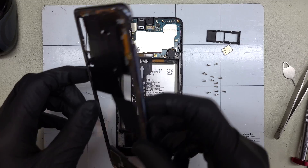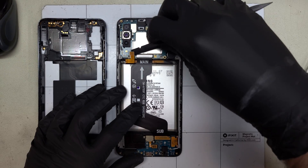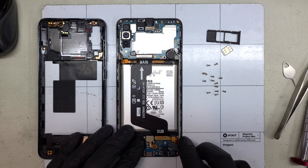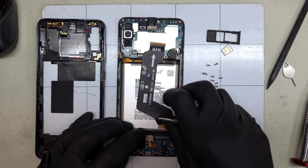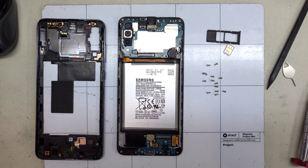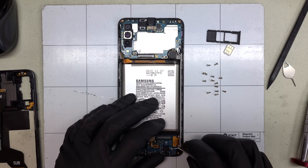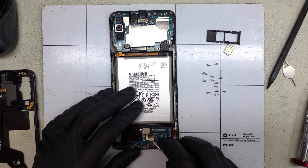Removing the midframe reveals a main and sub board connected by a very wavy ribbon cable. Disconnecting the battery is pretty important. Then separating our mother and daughter boards by unplugging the large ribbon. I'll unplug the digitizer and OLED ribbon from the port. This is a weird one — the display connects to the charging daughter board, then goes up to the main board.